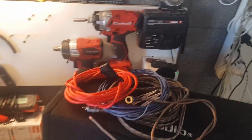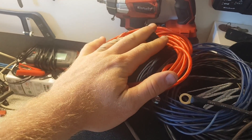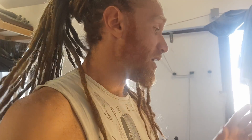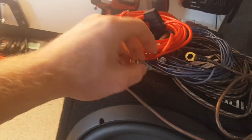The order of operations is: install the power cable first, finding a grommet in the engine bay to run it into the cabin. Then install the head unit, then the rest of the sub. The reason for this order is so I can do it all in one hit. If I install the head unit first I'd have to pull it back out to wire in the sub, and I can't do the RCA wiring on the stock head unit - only on the aftermarket unit.